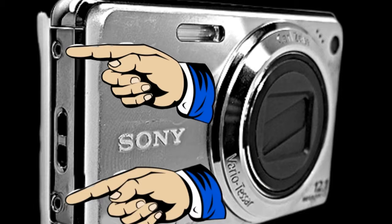Now we're ready to go ahead and start taking the camera apart. This is a picture of the side cover on the camera. There are 2 screws that you need to take out. Those little hands are pointing at the ones you need to do. On the opposite side of the camera, there are also another couple of screws that you'll need to take out.